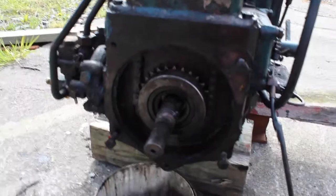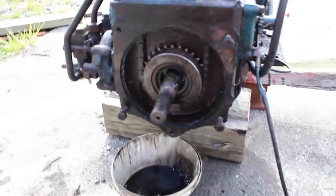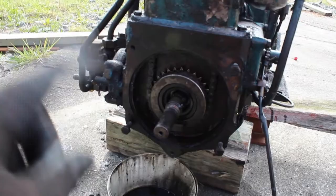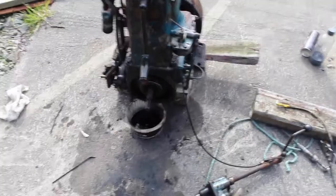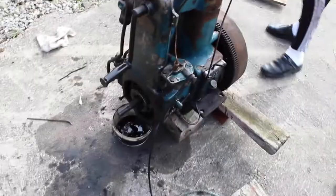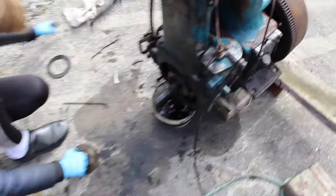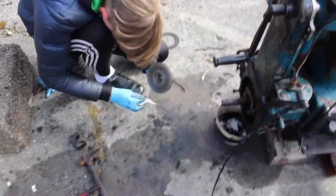In addition to that, we managed to take out that sprocket over there — that is a new sprocket, because the old one was completely garbage, absolutely gone. There is no separate ball bearing in there; there are just some balls inside the sprocket and the sprocket itself is the ball bearing. So we filled the new one with lots of tiny tiny balls like these. It was quite hard to fill because they kept popping up, but we managed to do it. It sits there very nicely — if you turn it now, it turns lovely. And thus we will start the assembly process.